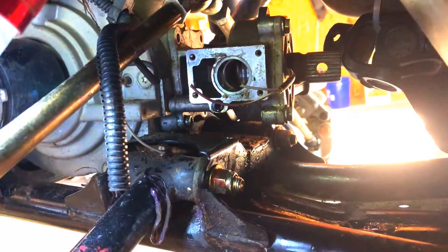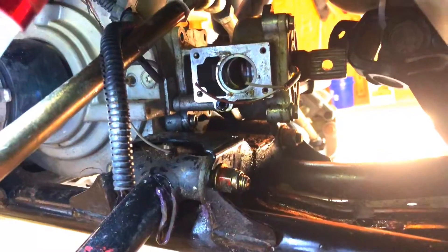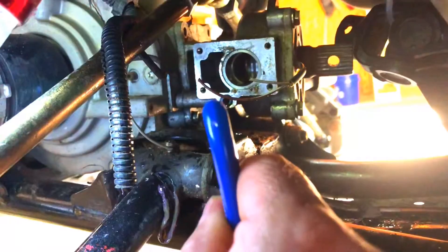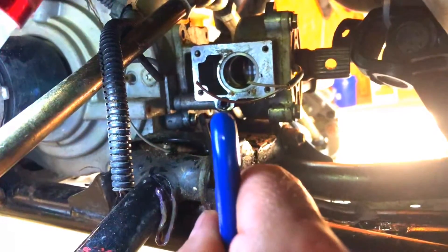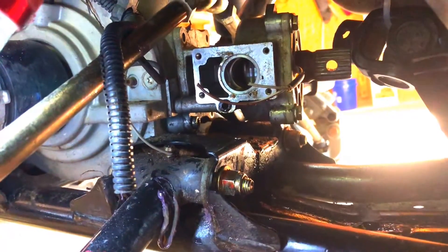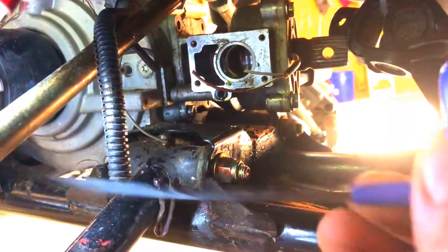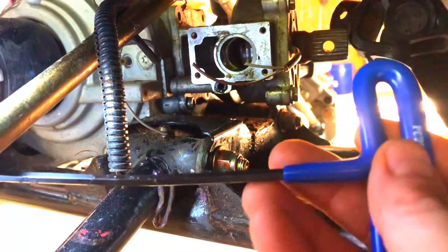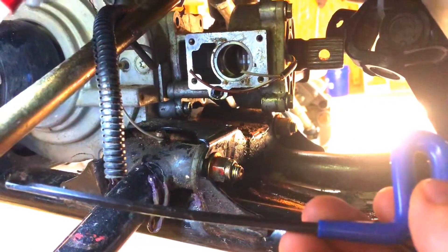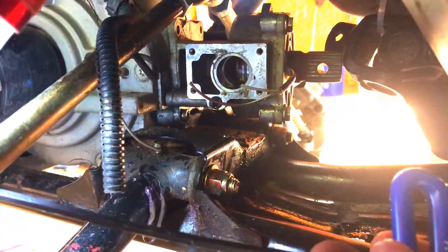Doing the pinion plate here has proved to be a challenging job. All you gotta do is take out four bolts — yeah, that's always that easy. This one right here I couldn't get at. I unbolted the diff, it wasn't moving. Finally I had to go get some new metric T-handle Allen wrenches, which I never had and always should have.